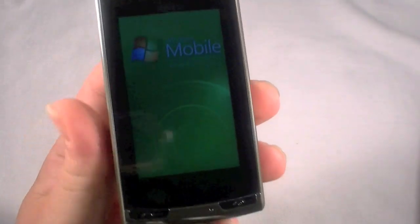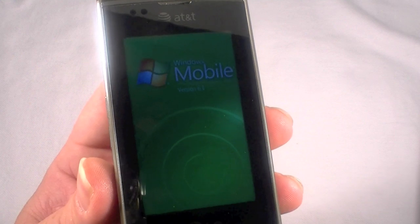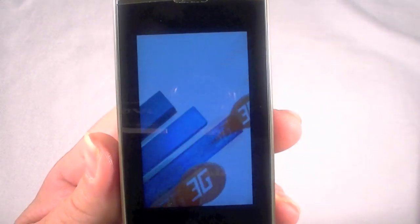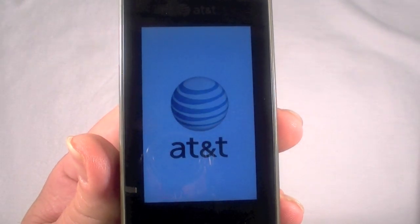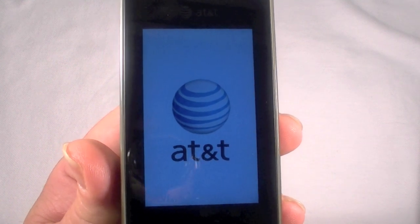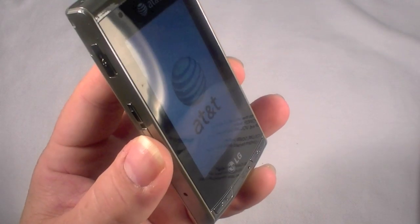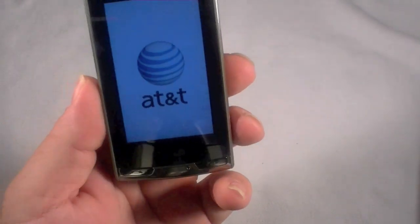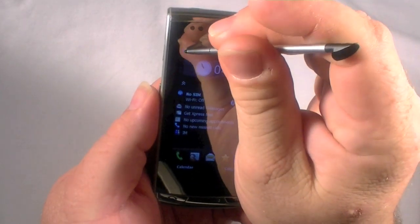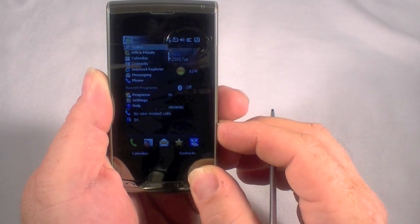Windows Mobile 6.1 was really slow on booting, and it should come up and give us the align screen, which will basically tell us it was a successful hard reset. And we will wait — and there we go. If this doesn't come up with the setup screen, then I let one of the keys off a little too early. Once again it's the volume down, the camera button at the same time, and the End button all at the same time. And we failed — this one failed. So we'll do this one more time. I knew it booted up a little bit too quick that time.